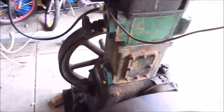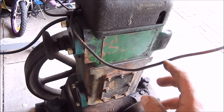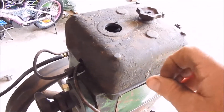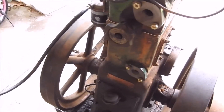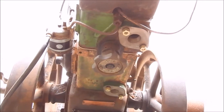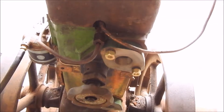Interestingly, the head must have been reconditioned at some stage because it's been painted. I thought the bump clearance might have been out because the exhaust valve had left a ring - just a little ring on the top of the piston - and I thought the bump clearance must be wrong. But I checked it and it was actually spot on, so I'm not sure what was going on there. The compression on it is really good - it's still got the honing marks in the cylinder. It's probably a chrome cylinder so they'll stay there a long time, but the rings are like brand new. It will run with the compression valve half way - it's got that much compression.